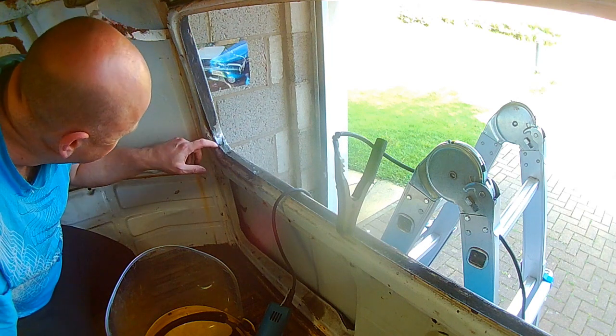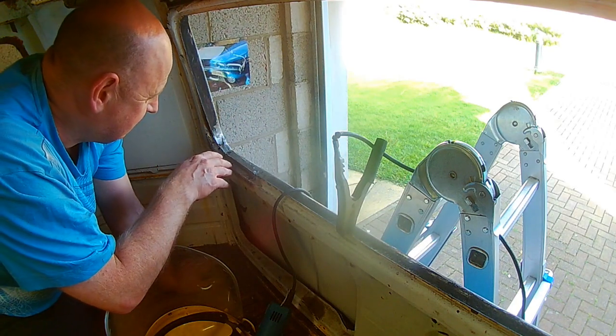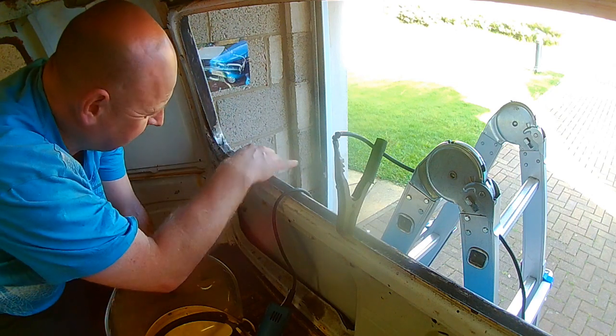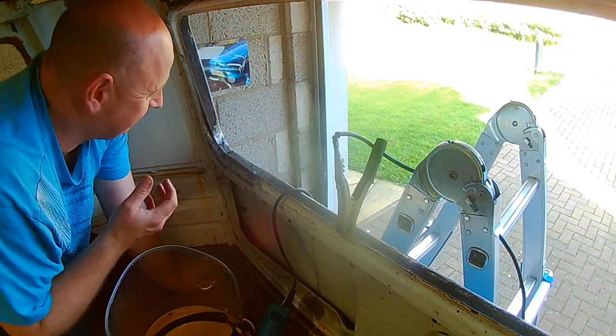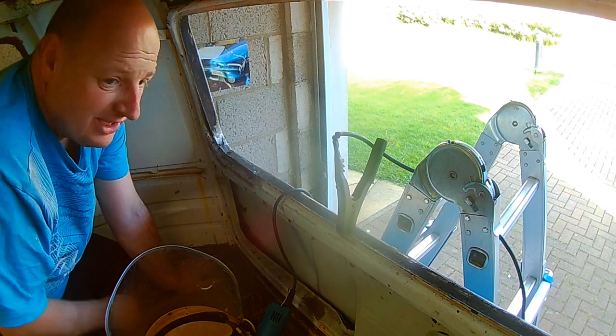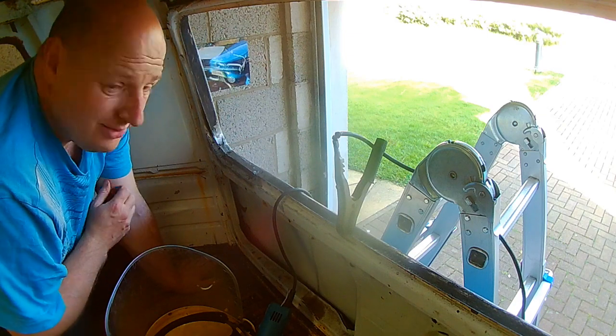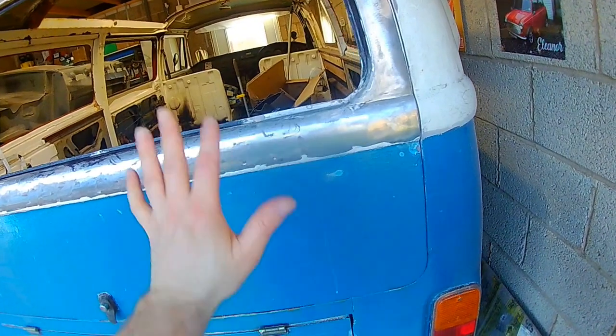It's a bit messy around here. I'm going to go around with a very fine layer of filler just to tidy it up slightly. This is all covered by the rubber that holds the window in, so it's probably OCD taking over, but yeah — light layer of filler, get it all flat, let it go off, then paint. Job done. Here it is with the light layer of filler on — really pleased with it, it's looking good. Just need to give this whole top panel a few layers of epoxy primer and then the repair to the tailgate is done.